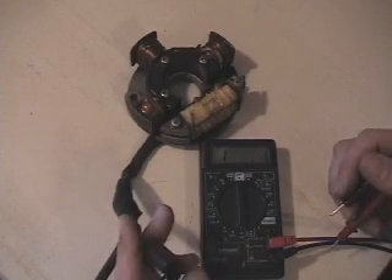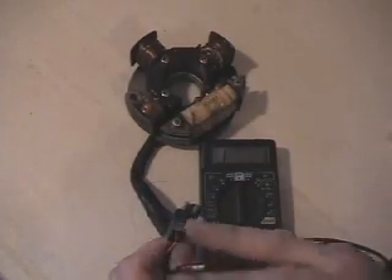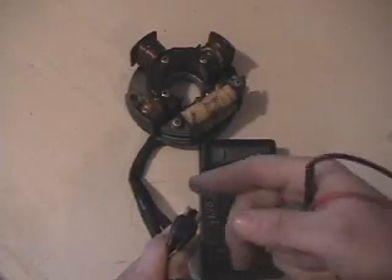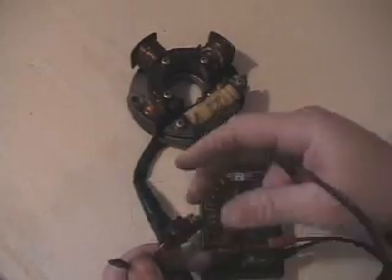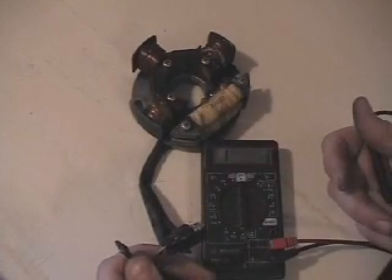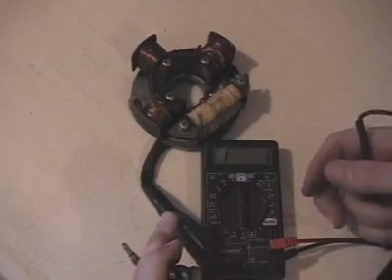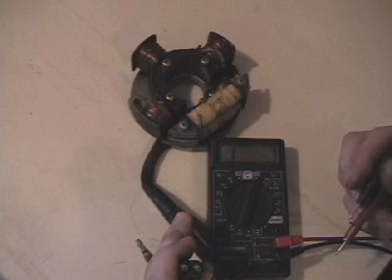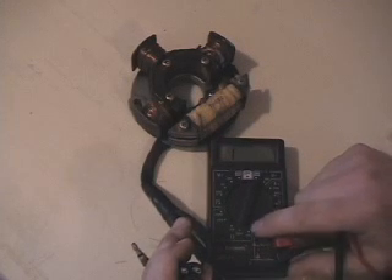Once we know the lighting coil is okay, we can move to the three-prong connector. This extra wire here is actually your ground, and there's a separate plug that plugs into that — it should be right next to where these plug in by your CDI box. I go by wire color sometimes, but wires can be spliced or changed color-wise year to year, so I go more or less on the orientation of the plug. On this unit, I put female down and the two males at the top.